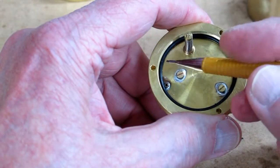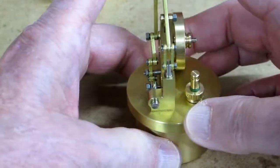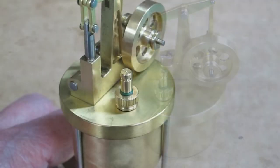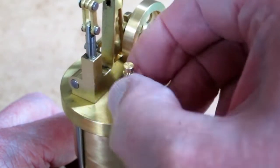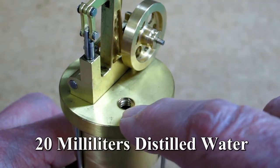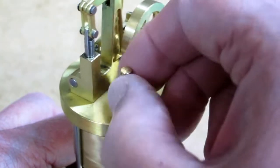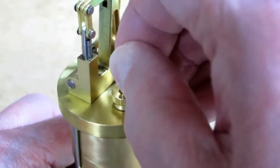There's an O-ring here that seals against the boiler. You just close it against that O-ring and give it just a little more — that's good enough. If you know this boiler is empty, then you can unscrew this pressure relief valve and add 20 milliliters of water with a syringe or a small funnel. Put this back in. When you tighten this down, it just needs to be firm — you don't have to tighten the heck out of it. And you should check to make sure this is free to operate.